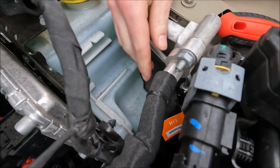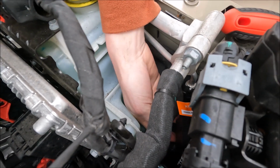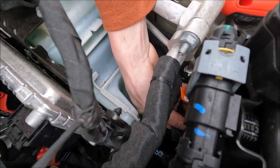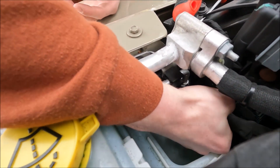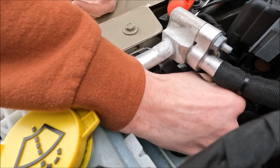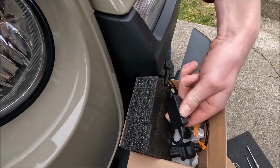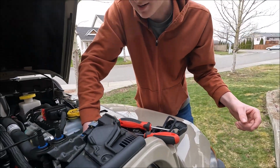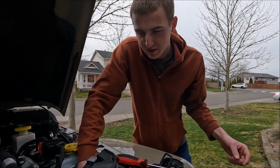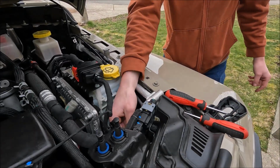This can be a little tough because you have a little bit of extra with some of these LEDs. So when you're looking for one, you kind of want to look for ones that don't have big ballasts, because they won't fit. You do have a little bit of give because the cup is pretty big. So these bulbs have a ballast here, and you have to tuck that in. You want to tuck it in on top, because the pins for the cap, if you put it on the side, it'll interfere with the pins. So I've got ours tucked in the top, got the cap back on here, and that's it.